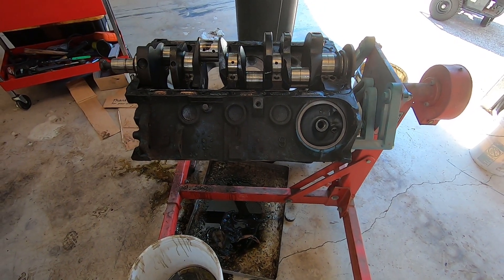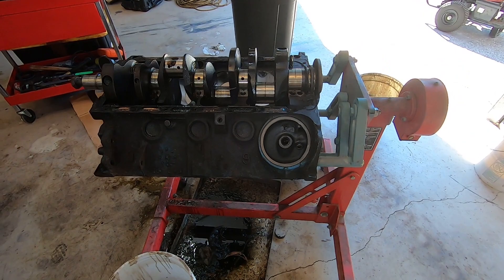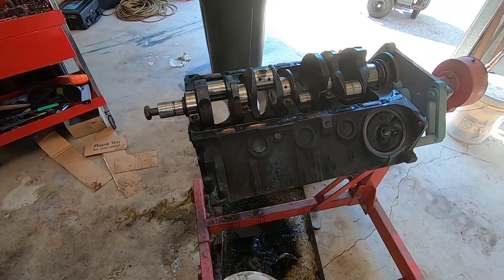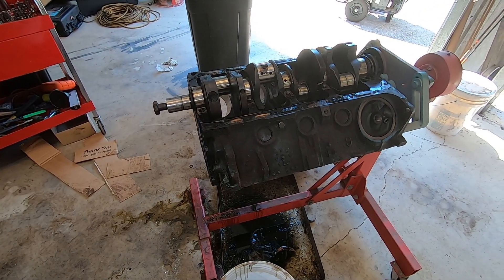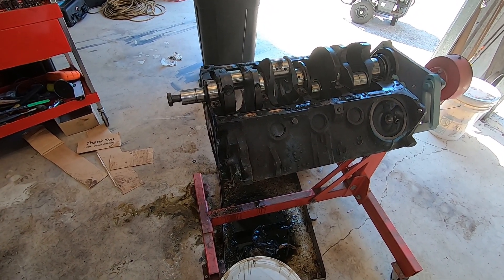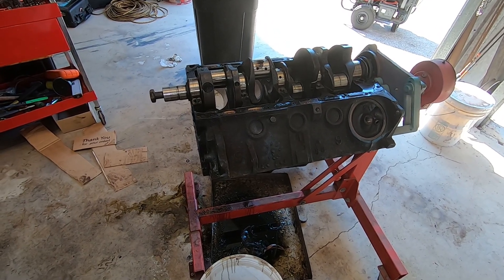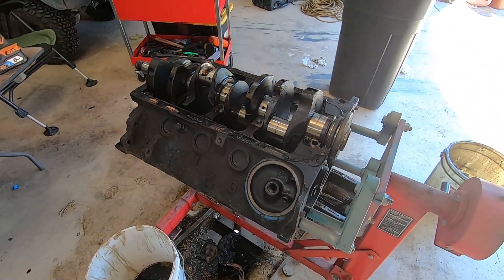That's about it for the teardown. The next steps are to get stuff off to the machine shop, get it cleaned up, and get a few more parts on order. As soon as the machine shop verifies what I already know — I want them to double-check that the bore size is the same and that it'll clean up well with no big scratches or cracks — I'm going to magnaflux the block to make sure there are no cracks, and same with the heads. Once I know everything's good, I'll know what parts to order and get them coming this way, and we'll see about getting it put back together. I appreciate it very much, you guys. Please like and subscribe and you'll see when the other videos get posted on the build. Thanks a lot.